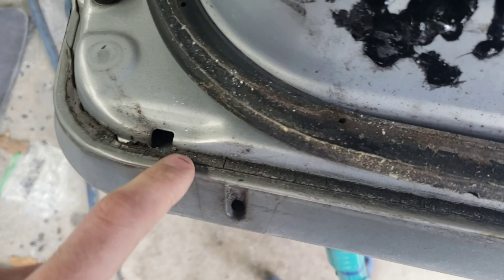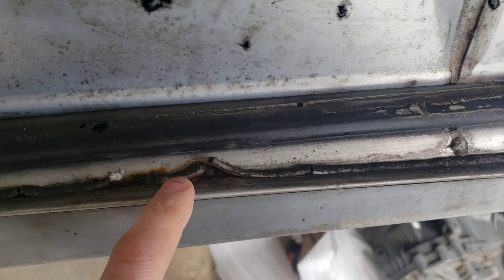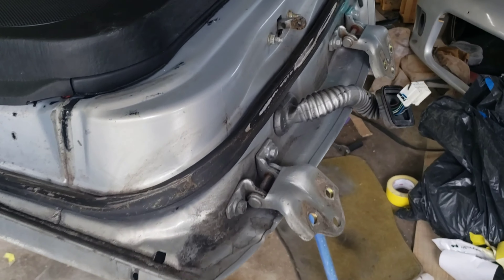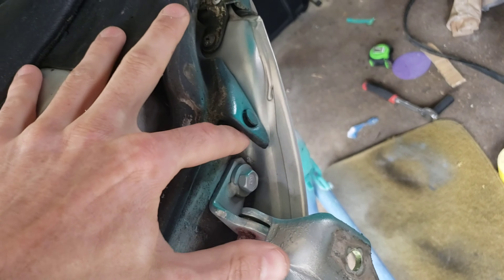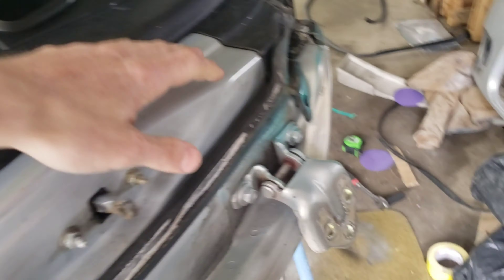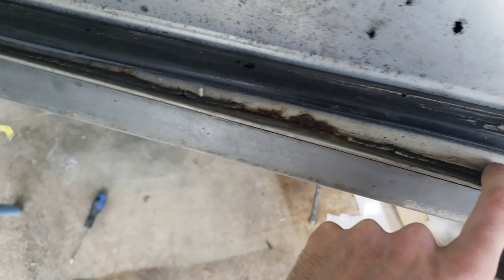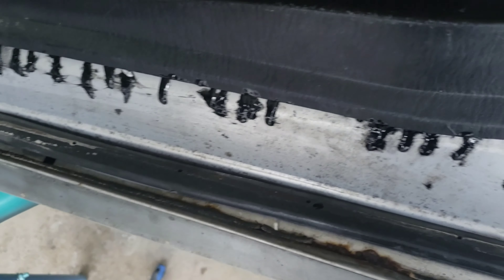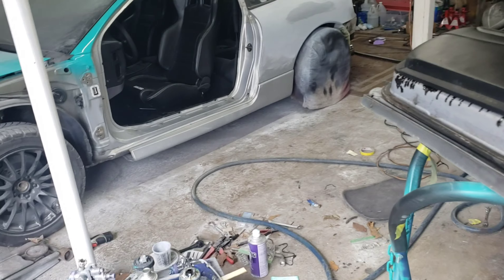The only thing I am worried about is the seam sealer down here did the same thing as on the passenger door — it started cracking up right around here, as you can see, and it just gets some rust in there. So what I'm going to do: I'm going to pull the door panel off, disconnect all the wiring, and pull the weather seal off. Once I get that off, I got to clean up the overspray on the seal — I must've done that when I painted the roof. Then I'm going to scrape all this old seam sealer out of here, convert this rust, put new sealer in it, and we'll be on the way. Hopefully I can get this scuffed down nice and quick and we can get this thing painted today.